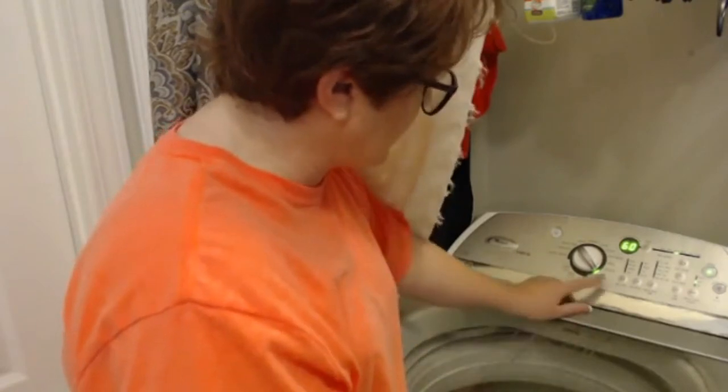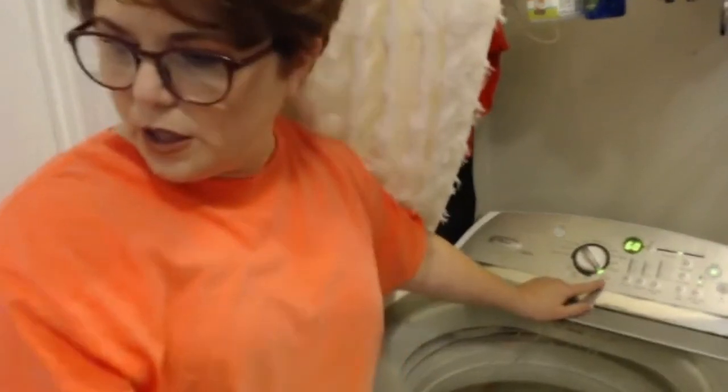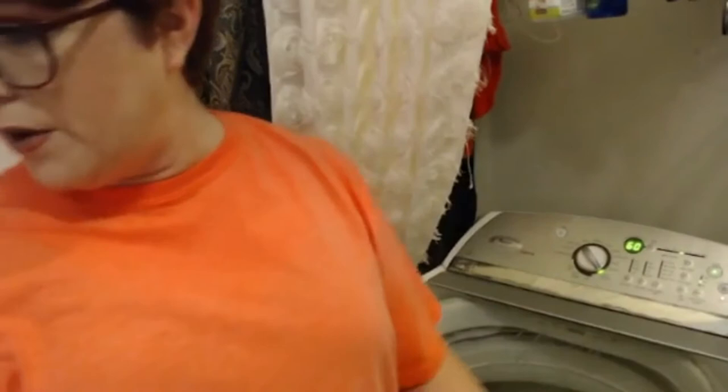That's all there is to it. If you've got a clean washer cycle, use it and just put some bleach in there. It'll keep your clothes from smelling like they're souring. Your darker clothes — the ones washed without really hot water and without bleach — tend to get smelly after sitting in there five or six hours, and it's actually because your washing machine is dirty.